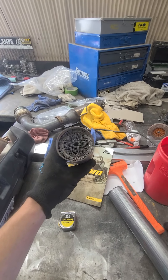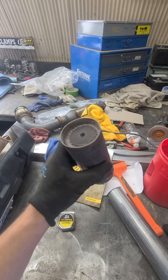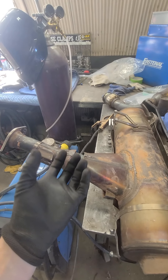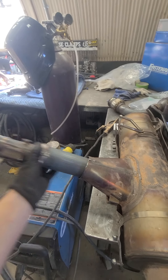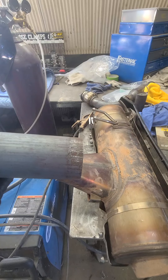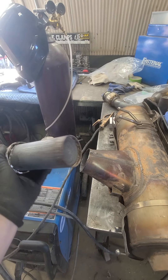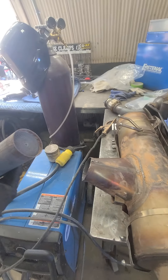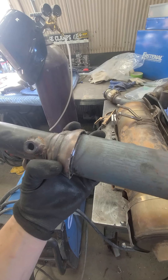I tried to drill it out - somebody suggested using a cold rod or drilling - no way, that's going to be a nasty dirty job. The way to do it is to make one cut and use a hammer, because it's a press fit inside the muffler pipe. It will just come out - it's probably about three-quarter inch into another pipe. It's a two and a half inch pipe: you cut it, knock it off, it comes out. We're using a bandsaw right now, but you can use anything you want to cut it.